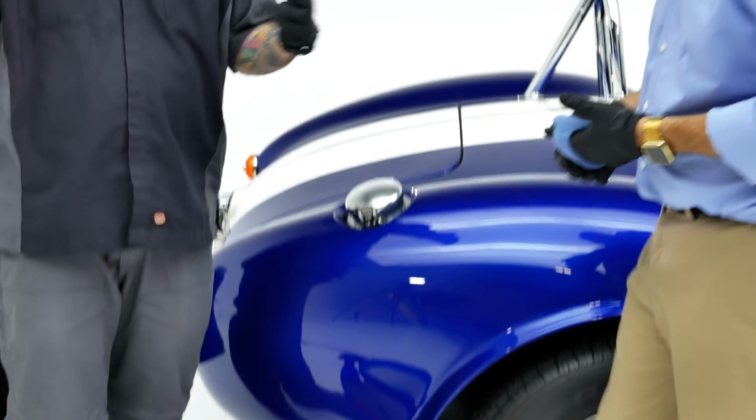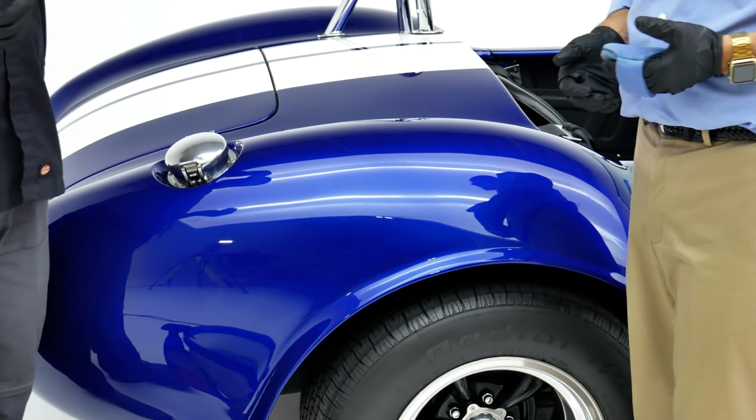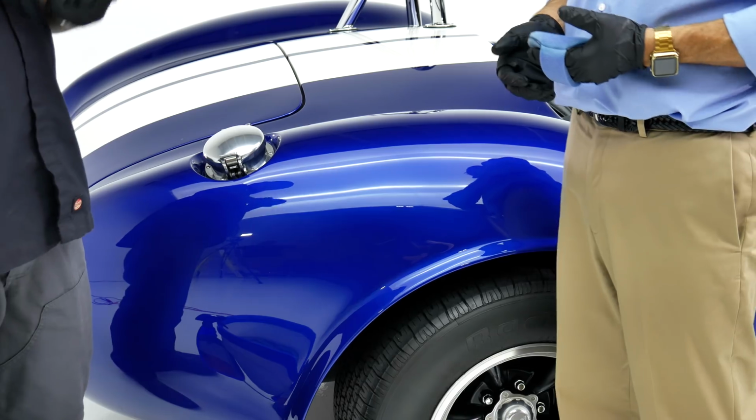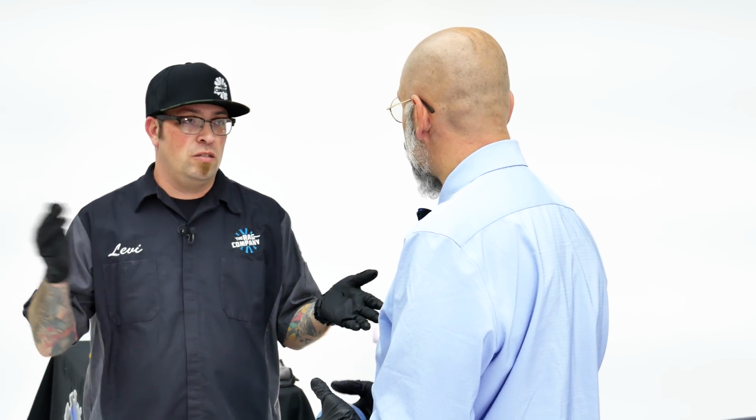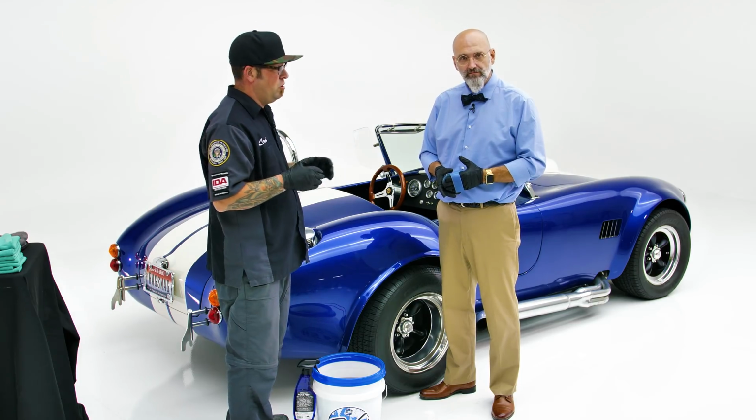So, well, I appreciate it, Yvan. Hopefully you guys understand that a little better now. Again, very simple process. Anybody can do this. If you can apply a wax, you can apply Gloss-Coat. And you've got that long working time. It's humidity cured, so it's not going to cure instantaneously, hence we use the OptiSeal. That way it continues to cure safely. Depending on the humidity, it can be anywhere from a week to 3 weeks to a month possibly. Just depends on the area and the temperature and the timing that you're doing it in.